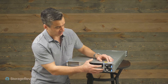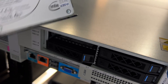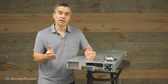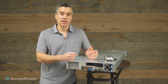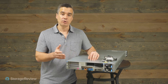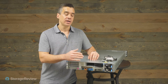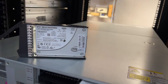Our model has four SSDs in the back. These first two are Intel S4510s — two SATA bays, which are great for putting a boot image on there if you're going to run VMware, Windows, or whatever you want. There are also two M.2 bays inside where you can do the same sort of thing. A lot of organizations prefer their drives to be externally accessible, so these bays come in really handy.